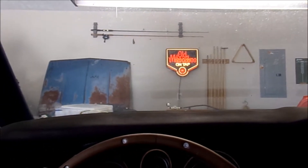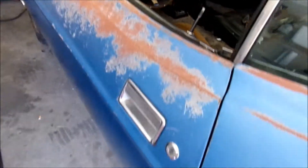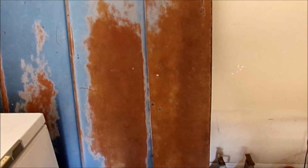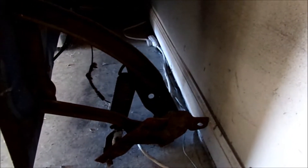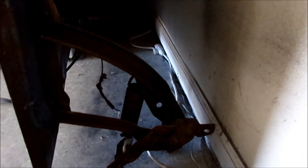All my glass is good. I'm going to get to work on this thing. The next time you see a video on the Mustang, it's going to be starting it. Tonight I may work on that some more. You haven't seen the hood yet — but there it is. That chrome piece on the front of the hood: I need that, or I may fabricate something. It's all surface rust. My hood mount hinges are all rusted up, so I'm going to start working on them. I'll probably take them off the hood, grind them down, clean them up, paint them, then really grease them up and try to get them to function better. These hinges the way they are start bending the hood generally whenever you're working with them.